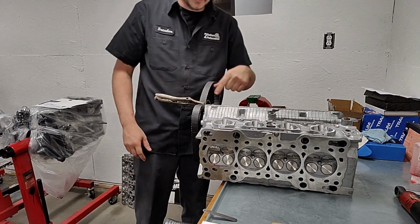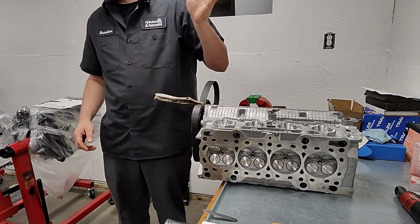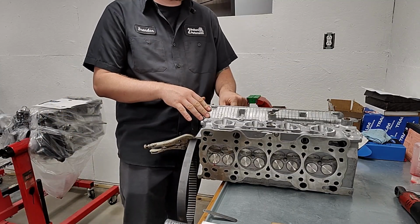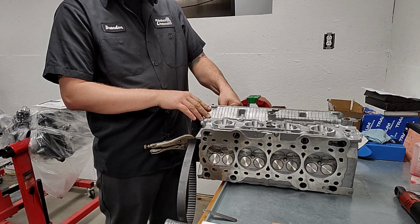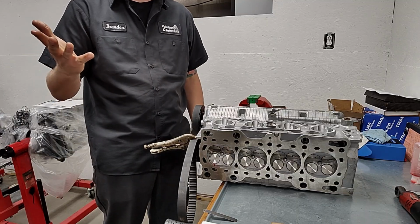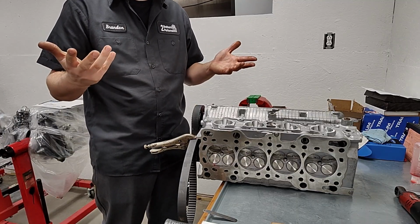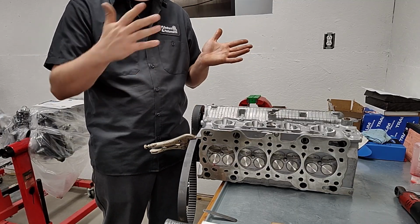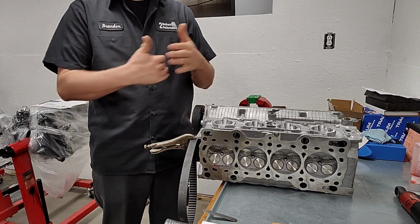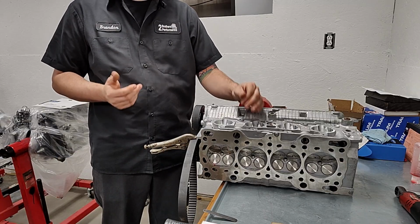Put my real springs back in, take the dummy springs out, and then clean the bottom, clean the block surface, and put it all together. With some of the Web cams, the first cams we put together on my brother's head, the chart was really, really wide open, which is fine, but I ended up at like -1 on the exhaust, +9 on the intake. It seemed odd, but it still got our lobe center where we needed to be.